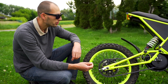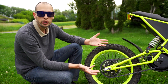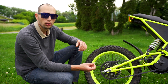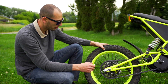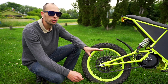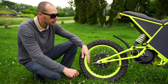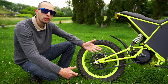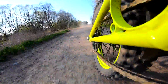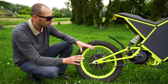Being able to remove the rear wheel is convenient because you can play with the rear sprockets — a smaller one gives lower torque and higher maximum speed, while a bigger one gives incredible torque and a slightly lower maximum speed. Obviously check the pressure in the tires, and that's pretty much all the maintenance needed on a cyberbike. When putting the rear wheel back on, make sure it's aligned with the front wheel — the easiest way is to use a straight plank from the rear wheel to the front and see if it touches all four contact points.